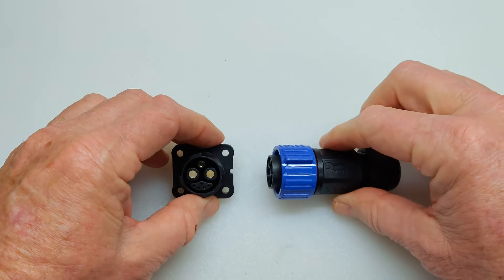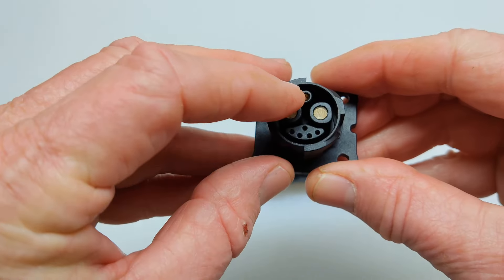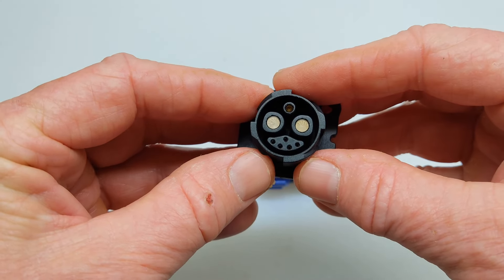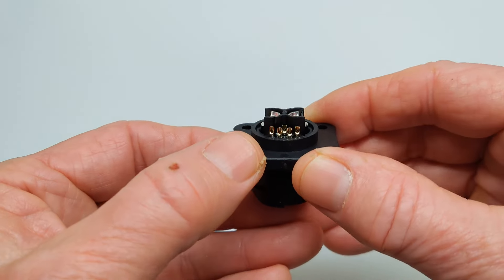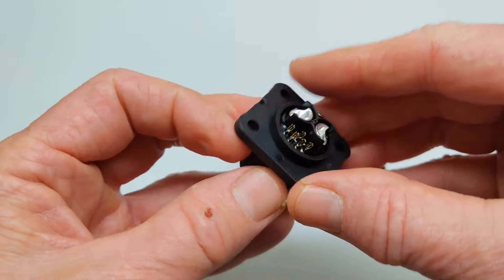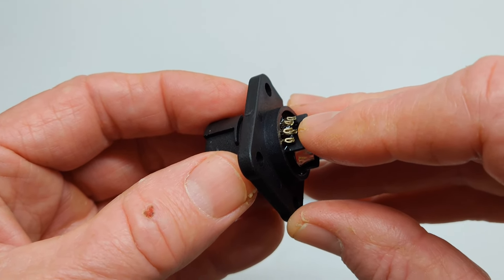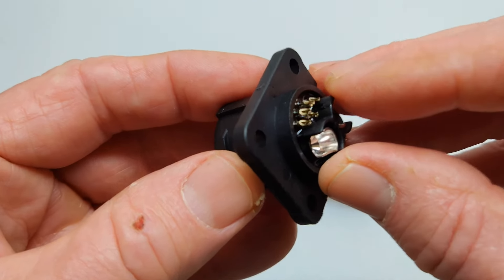What's a little more difficult using this one is that since it's a 2 plus 1 plus 5 pin setup, these are going to be your power pins here. They're pretty large, so you'll be able to run the wire at the 60 amp rating. And then you've got your 5 male pins in here. On the opposite side, this is where you're going to have to do some really delicate soldering. You can see it's almost like a little cup, and you can lay your 8 or 10 gauge power wires in there.